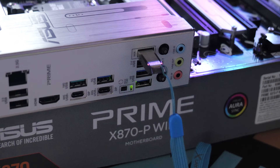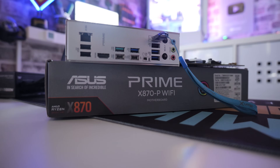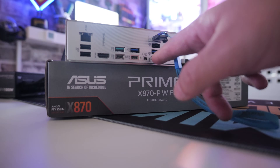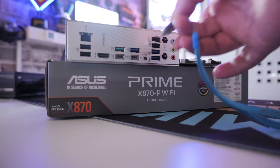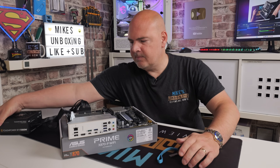Essentially what we're looking for is for this BIOS LED to stop flashing and completely turn itself off. Once it's done that we'll be able to turn off the power and disconnect everything. If you have a fully built system you may find you can now turn on your PC and it will actually boot up. Just leave the computer alone — let it do its own thing. If it goes on for more than about five to ten minutes and the LED doesn't change speeds, something has gone wrong and you can turn off the system and start over. The BIOS LED has now stopped and the computer has turned itself off — the BIOS has been flashed. You can now remove your USB drive and turn off your power supply.